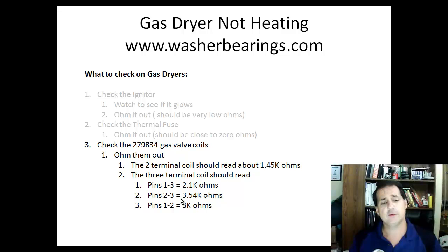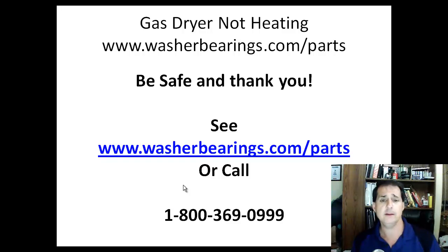Typically, if you see your machine light up, shut off, and then fail to light up reliably after that — it worked every time on the first cycle — it's probably those coils. They're about 20 bucks, not too bad. So again, you want to be safe working on your machines. Unplug them, and then you may have to plug them back in to do some electrical checks and visually check the igniter to make sure it's working.